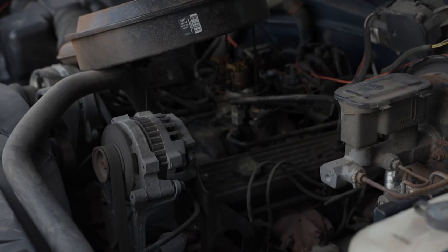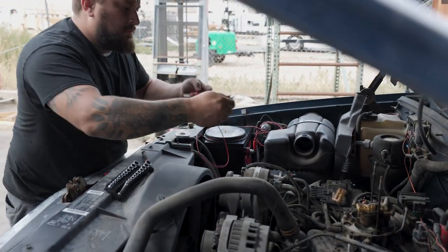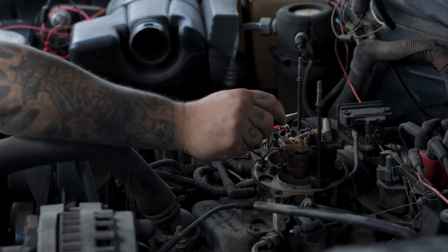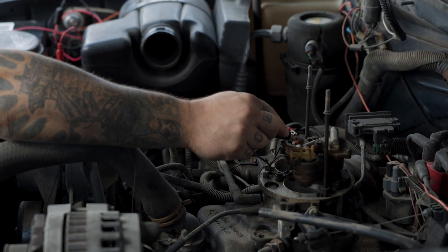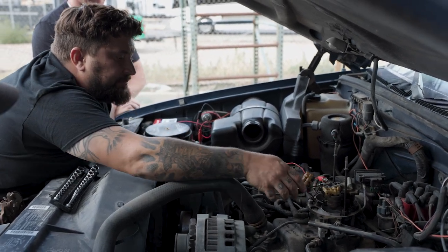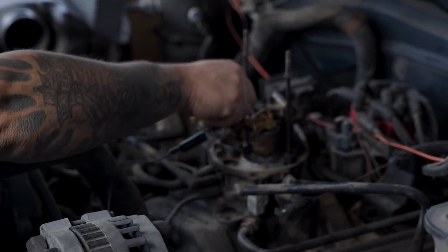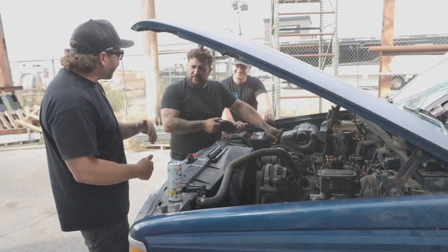Sounds a lot better. So I'll go hit the ignition - if it squirts fuel, that means we're good, right? Yeah, it should have fuel pressure as soon as you turn the key on. Just turn the key on, leave it on - there you go. Okay, it only runs for like two seconds. Fuel pump's not running - yeah, it just comes on for two seconds. The injectors are fine though. Cycle the key on again so it'll just be done, then it squirts a little fuel.